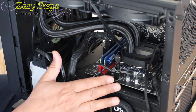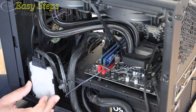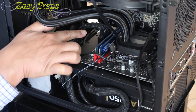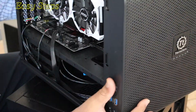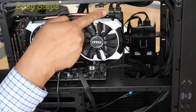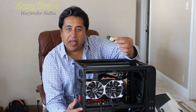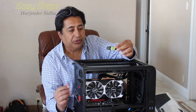I'm going to finish up plugging in all the cables. So far we've covered installing the motherboard, water cooling system, graphics card, and power supply. I also installed the accessory drive. I ran the cables from the power supply: the 24-pin power cable plugged into the motherboard, and the 4-pin power plugged in as well. I ran the remaining cables through and tied them down, then ran power to the graphics card. All the computer parts are assembled. I have a Windows 10 ready USB disk — for how to make a bootable drive, please check my other video.